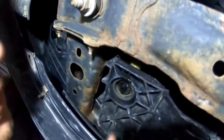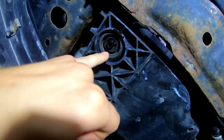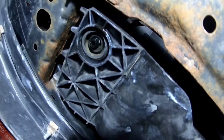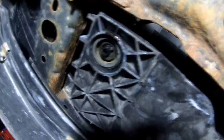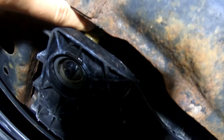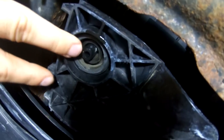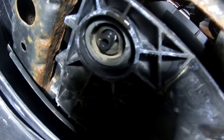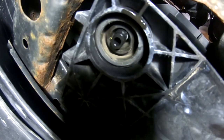Yeah. It's going to come in and the petcock should be right here to make it accessible and easy, but they don't do that. So what you have to do is get a three-quarter socket or wrench. This white socket right there — or bolt — you're just going to turn that. Once you start turning that kind of clockwise, it'll start slowly draining out of here. And then we also have the cap from the cooling expansion reservoir open, so it'll flow evenly as well.